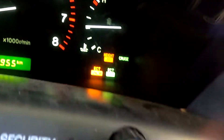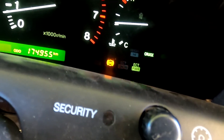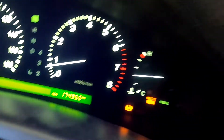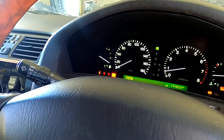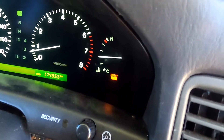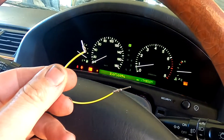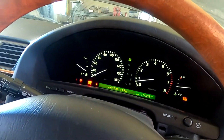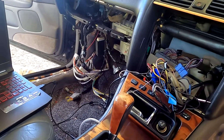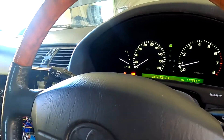It actually brings up diagnostic on the dash. We're in diagnostic mode — look at the dash. This has got a problem with the ABS and the height control has been removed, and it is going nuts — the airbag lights are flashing, everything's flashing. That's what happens when you put it in diagnostic mode. So I'm just going to pull that out — that fault code there is actually for the hydraulic fan. But that's how you check the timing on a VVTi. Now we're going to put the aftermarket computer in and check it. I hope that was helpful — talk to you soon, catch you later.